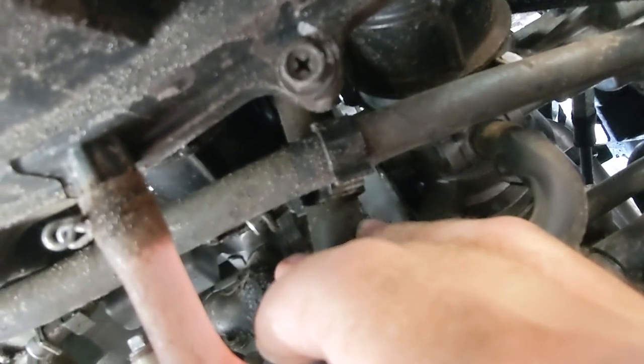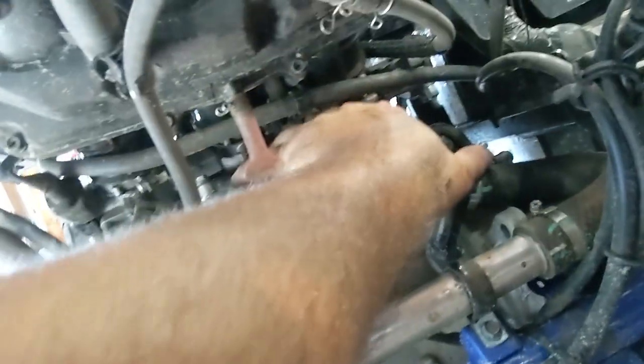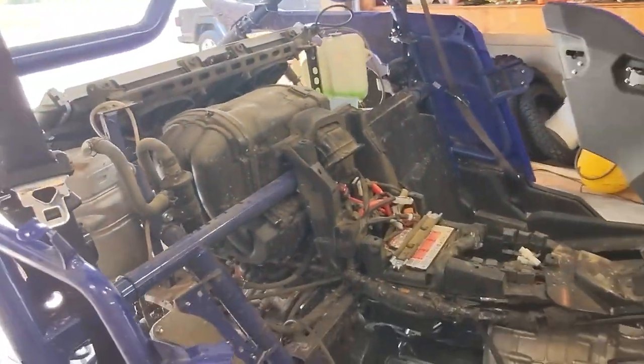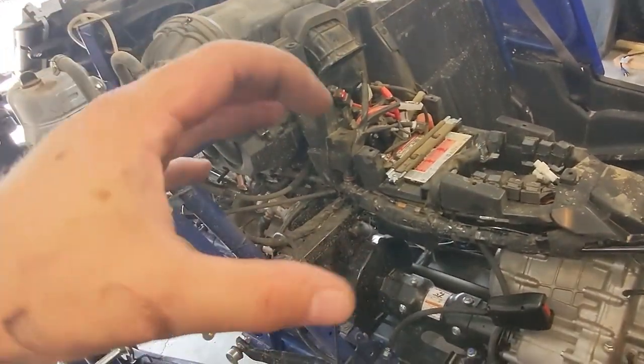See that white plastic piece? If you turn that, you're turning the butterflies. So I'm going to get to where it's failing and I can open and close the butterflies with my finger like that. If I push down on it, we're going to see if that makes it idle down. And if it does, it tells us it's not a vacuum leak — it's the throttle getting hung. The way that felt with my finger does feel like that's going to be the issue. It's not bottoming out soft, I don't hear the butterfly slapping, I feel it kind of sticking.